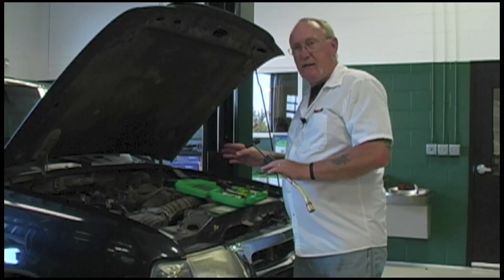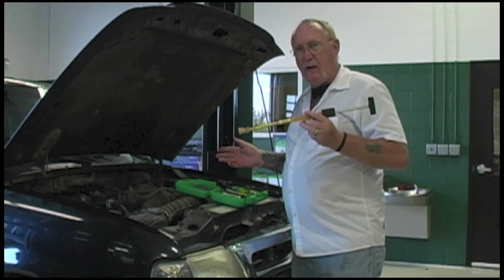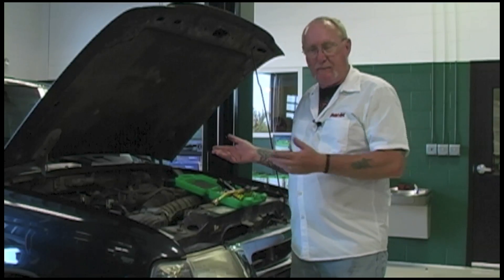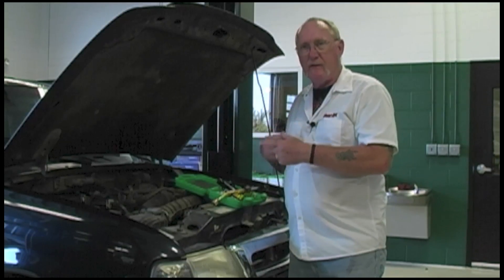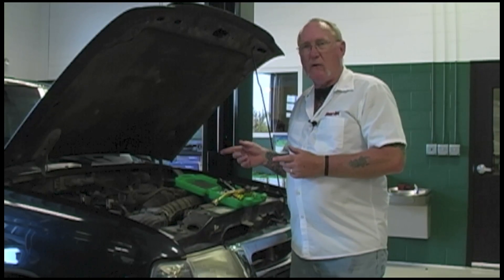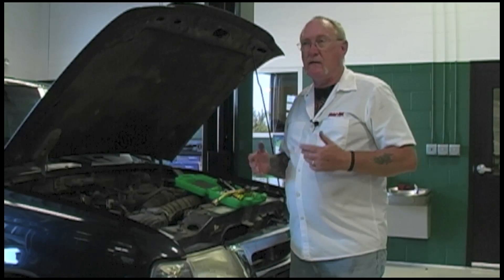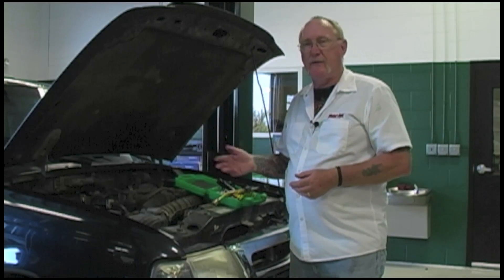If you're absolutely 100% sure there's no dye already in the system, go ahead and inject just the amount specified by the dye manufacturer — one, at most two, ounces for big systems — then allow that to circulate through the system. How long will it take for the dye to reach the leak source? If it's a big leak with a small system and there's a lot of oil circulating, it should get to the leak site pretty quickly — maybe within 20 minutes. If it's a small leak in a system where oil primarily stays in the compressor and there's not much circulating through to carry the dye — and it's rear AC — it could take two or three days before there's enough to see. Advise your customer accordingly.